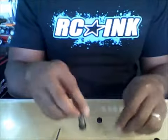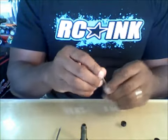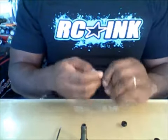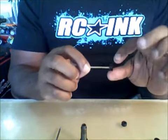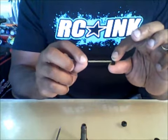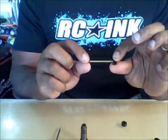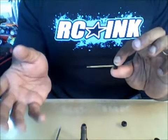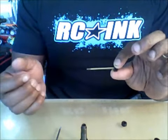Well, because the UFO pistons have a very tight fit, basically they're press-on, it gives you a really snug fit, and because there are two points of contact, your shaft is actually locked onto the piston, and because the piston can't wobble around inside the shock body, you lose a very considerable amount of shaft play on the end of it, which equals a lot smoother action, a lot longer lasting shock shafts, and basically just makes your car a lot smoother.